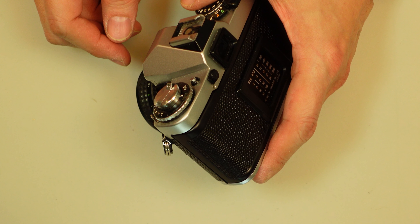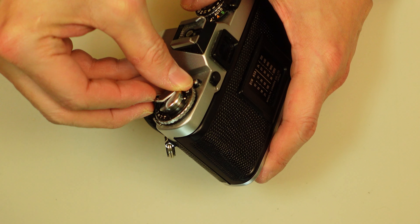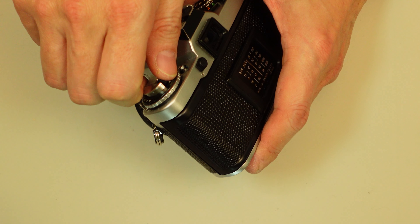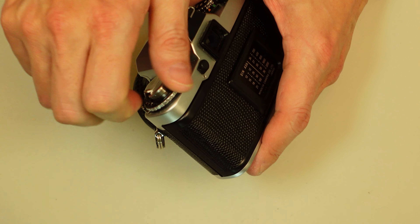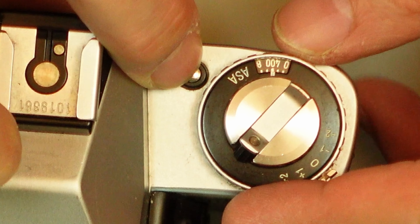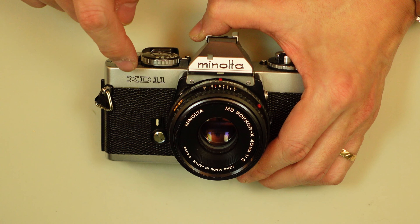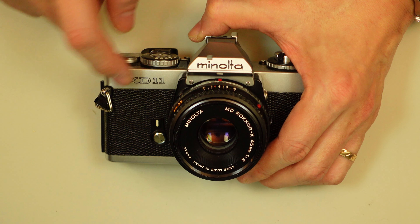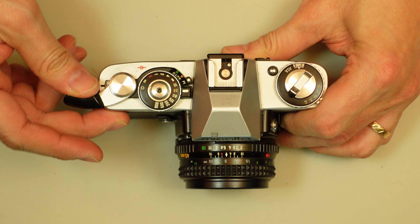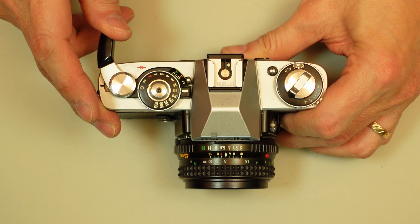It was a feature that seemed to be popular, possibly introduced and certainly popularized by Japanese camera makers — a much welcome change from the traditional knob rewind. This small button allowed you to change your film speed; you'll notice this one's marked in ASA. This camera was marketed in Europe as the XG7, however if I'm wrong I'll make note of it in the description. This had a single-stroke film advance, which meant you had to advance the film in one stroke — you couldn't do it in increments.